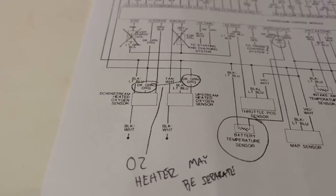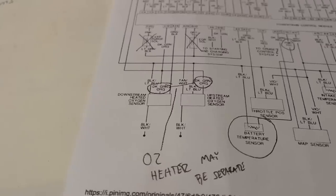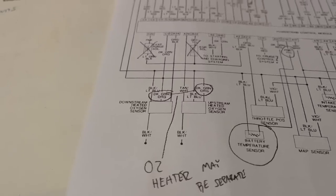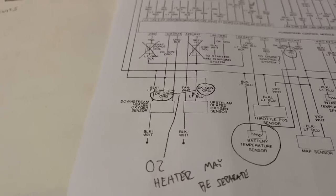There will be oxygen sensor plugs in your engine harness. You don't have to work too hard to figure that out. You need to weld a bung into your exhaust, or use a set of headers that already have one. Screwing the oxygen sensor in and plugging it in, not a huge deal.